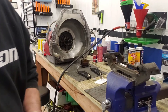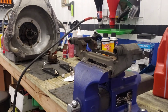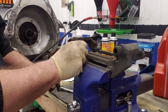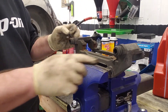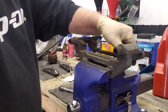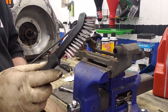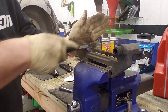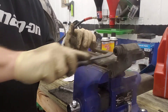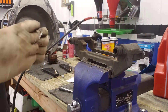We're on the bench. I've got the caliper bracket in the vise. A good brake job is all about preparation. You see these anti-rattle clips — this one is actually loose and falling off — so we're going to get rid of these. Take note before you take things apart how they are configured: they have a little tab, and the tabs stick out. Toss the old ones in the trash. Then take a wire brush — or your toothbrush, just don't brush your teeth with it afterwards — and clean the surfaces, getting all the scale out. Don't breathe that dust.